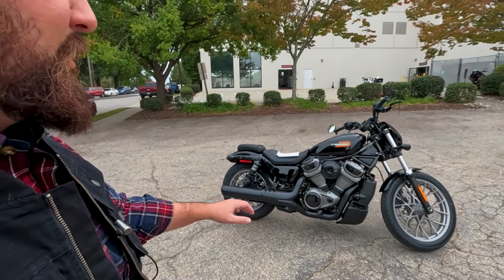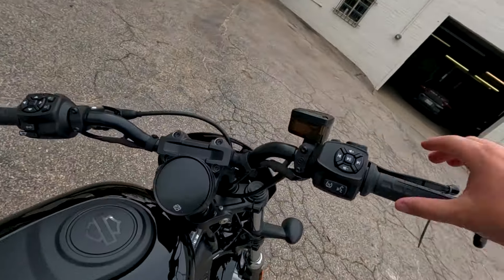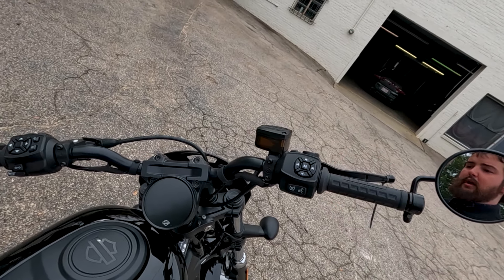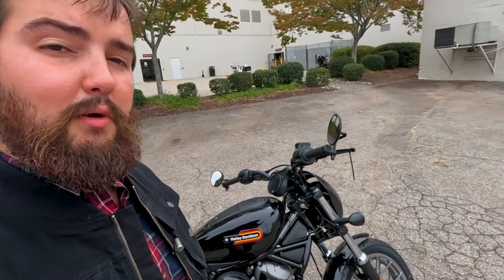Everything we do on the front tire, we want to check on the rear tire as well. We'll come back here, check our pads — they look good, thickness on the rotor looks good, no excessive gouging or anything like that. Check both sides of the tires, both front and rear. The cool thing about this checklist sheet is that it gives you a little checkoff, so if you had a pen, you could just go through and check everything off for the front and for the rear. That's it for T — tires.